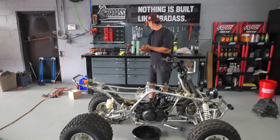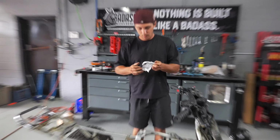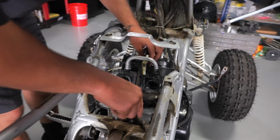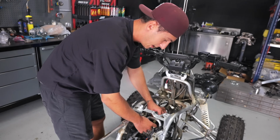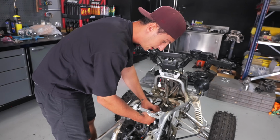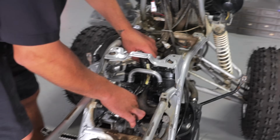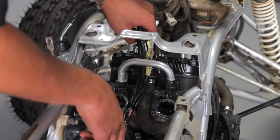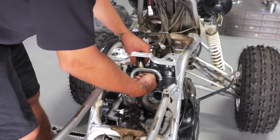All right, now that that is draining, I'm gonna put in the OEM crossover tube. Slide this in there. Your wire harness and hoses should always run underneath the crossover tube. I constantly see people putting that on top of the crossover tube. The correct way from factory, your harness and the hose from the reservoir will run underneath the oil overflow too, meeting up with that T, and that'll run underneath the reed, come up right through here.